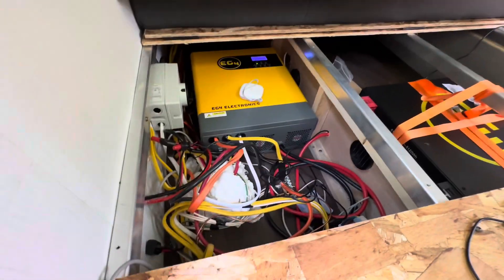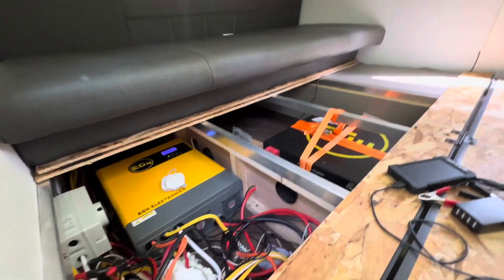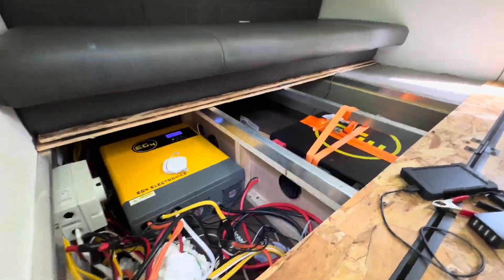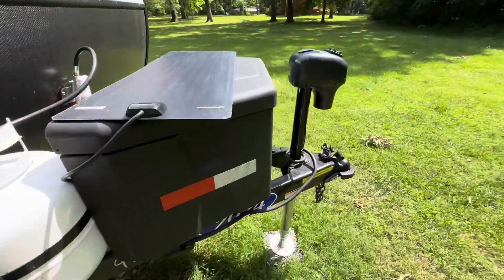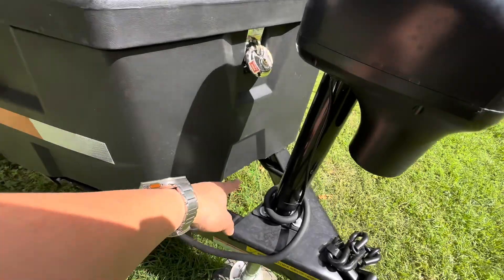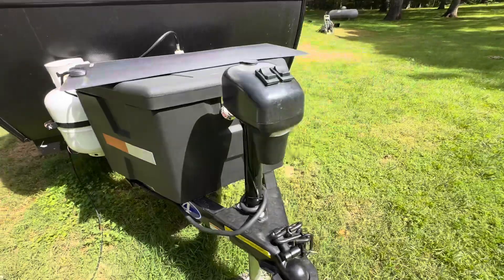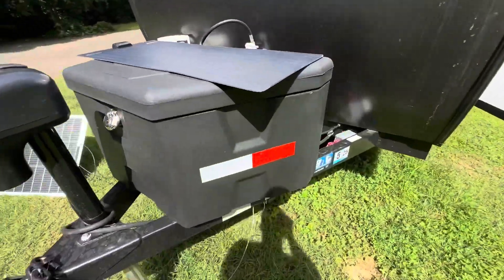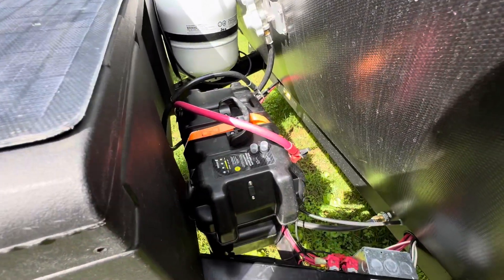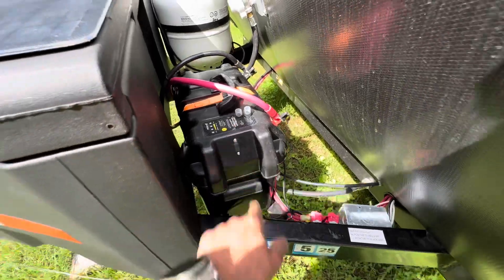That's how I did it — I interrupt the main line — and so far it's been pretty self-sufficient. It's powering the AC every day and does a really good job. As for the front, I rearranged the tongue a little bit. The propane tank was here, I got an electric jack instead, and installed this box which has the toilet and tools. Then I put a lithium 12-volt, 100-amp-hour lithium-ion battery in this front box.